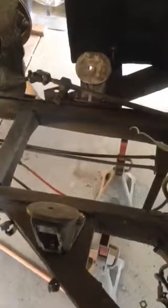So dusty. That's what I did last week — got the motor mounts installed, right and left. I retrofitted them with half inch bolts for strength. Last week also did the back lower portion of the car, and it's under progress right now. I don't know if you can see it. That's all new steel under there.